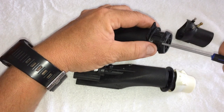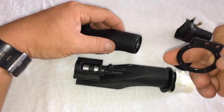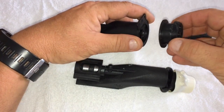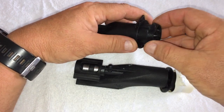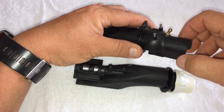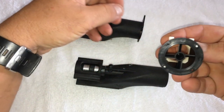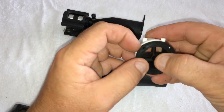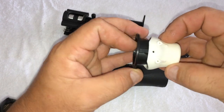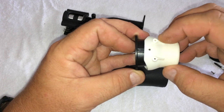We've got the stator housing and stator, and the transom plate. The transom plate goes on the outside of the hull where the end of the pump penetrates out through the hull, and the stator housing with the stator inside mounts over the top. You have your splash guard there, and then your steering nozzle goes over the top. Exact same setup for the short nozzle — the stator drops into the little slots. It's recommended that you glue it in so that it doesn't vibrate. The short nozzle has a different splash guard and mounts onto the holes in the middle, with steering control mounting holes on the top.